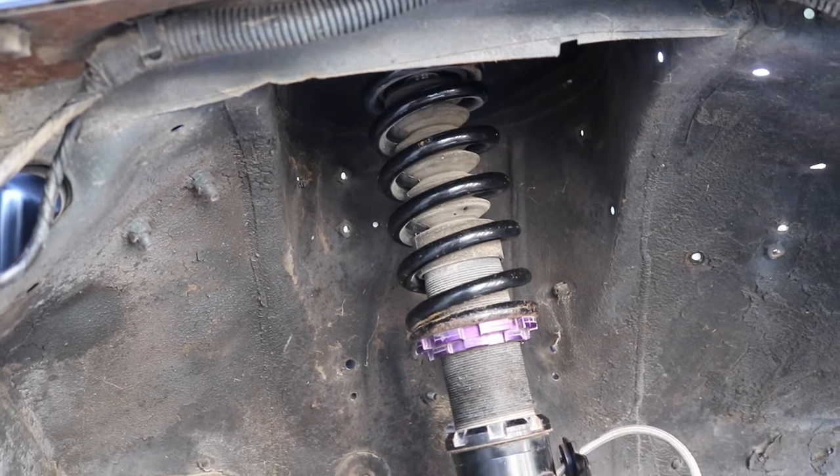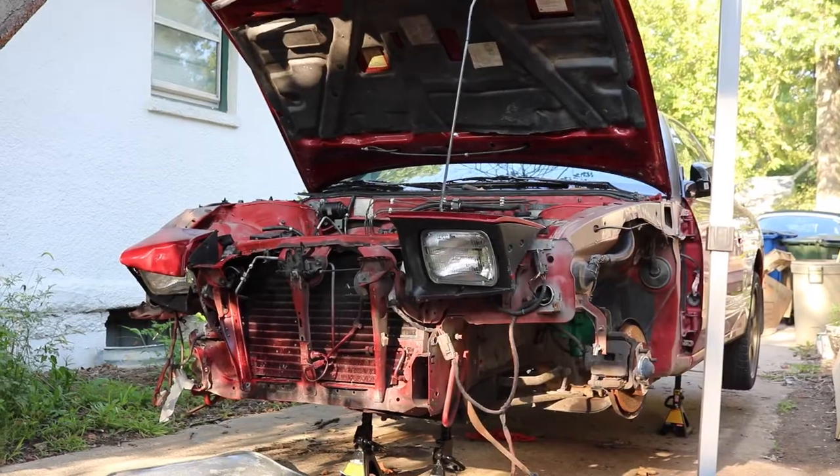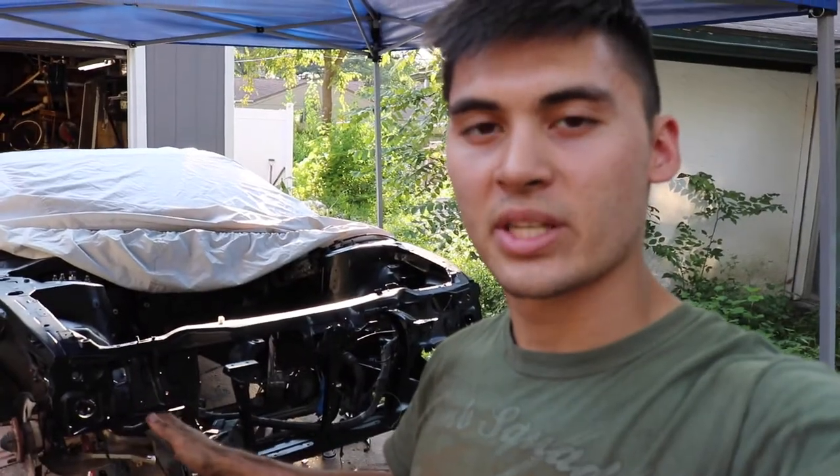Now to put the icing on the cake we have our fully adjustable D2 coilovers. It is 100% likely that the alignment is going to be off after installing all these new suspension and steering components, so it's critical that we hit the alignment shop as soon as this car hits the road. Our front end suspension and steering should be pretty set for the Teal 240 - we've installed tension rods, new tie rods, new bushings for the steering rack and steering column, and fully adjustable D2 coilovers all around. I'm pretty excited to see how all these new parts are going to make the car transform as far as handling goes once it gets back on the road. If you have any questions, leave them in the comments below, and I will see you guys next time.